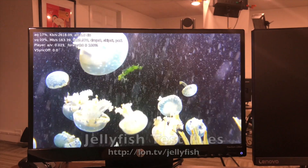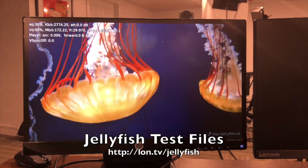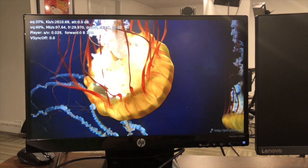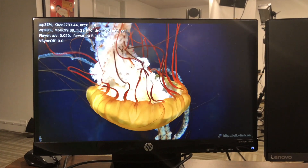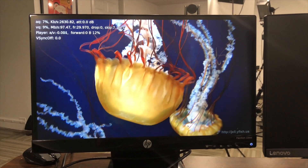Although it's doing okay on its thermals, it's performing so poorly it really doesn't matter. We also booted up Kodi and ran our 140 megabits per second HEVC file to see how that played back. We had a couple of skipped frames here or there, but surprisingly decent video performance with that 10-bit file being down-converted from 4K to 1080p — it was doing better than I thought. That's one of the things Apollo Lake can do very well: hardware-decode video.